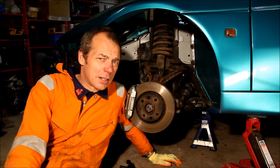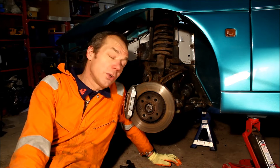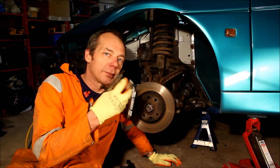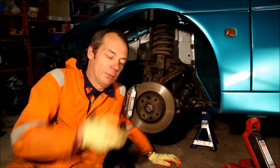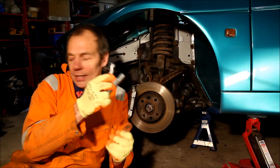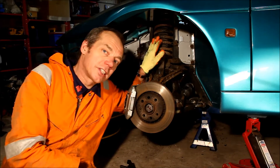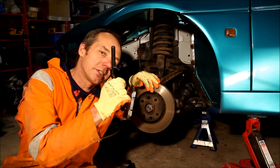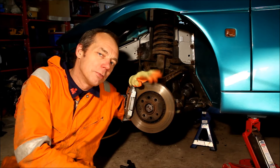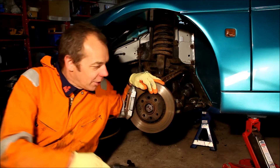Other than that, it's just a bit of patience and brute force. You will need a couple of other tools for dismantling: a decent ball joint splitter — I prefer the scissors type, but various types are available. If you want to dismantle the spring and strut assembly you'll need a pair of spring compressors as well, but we'll deal with all that in the next video. Just make sure you have your tools available before you get everything off.